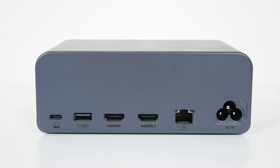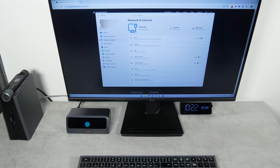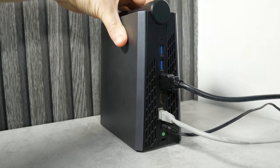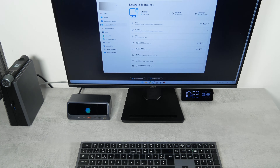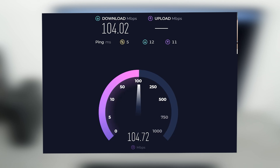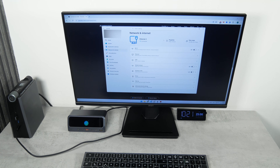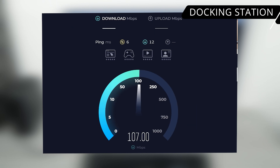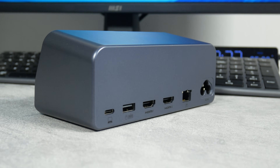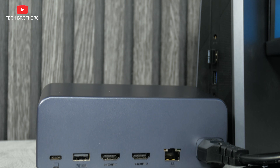I want to check the Ethernet port in this station. The Mokin 13-in-1 docking station has a 1Gbps Ethernet port. Although my internet connection is only 100Mbps, we will check whether it differs when connected to my computer versus the station. First, I connect the cable to the Ethernet port on my mini PC and check the upload and download speeds — they are just over 100Mbps. Now I plug the cable into the Ethernet port on the docking station and run the speed test again. As you can see, it is still over 100Mbps — that's very good. So if your laptop doesn't have an Ethernet port, this station will be very useful. But even if your laptop or computer has an Ethernet port, you can use the station for a second internet connection.